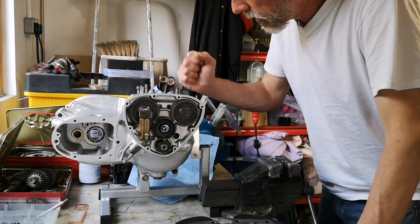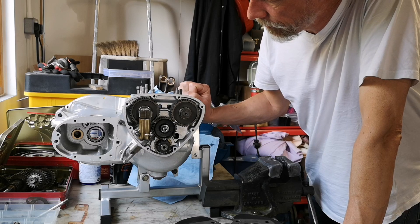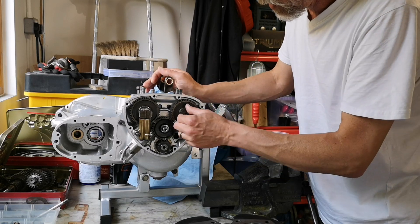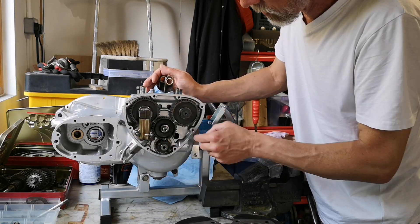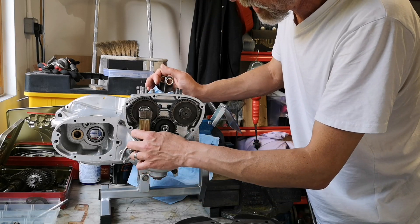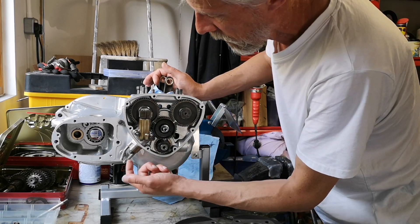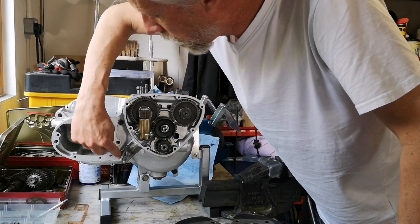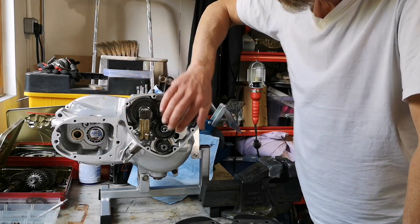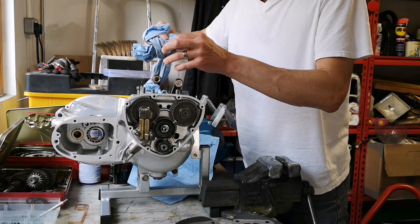It's a whole new day and I finished off all this last night. What I did was put a rod through the small ends, put a block of wood underneath so I could tighten all this up, and tightened all these nuts down. Put the oil pump on - that's all tightened down now - and cut the gasket down so it fitted a lot better. I also had to put in the two crankcase bolts because I was behind that, so it's a bit tricky to get to. That's all done and dusted, ready to go.